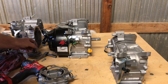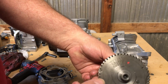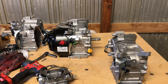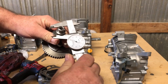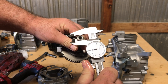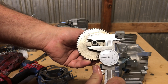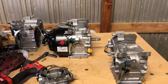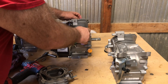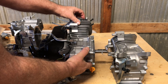The Ghost is not a Ducar. The camshaft from the Ghost has some numbers on it, but honestly it doesn't look anything other than stock. I haven't put a degree wheel on it or anything, but I'm not impressed. The camshaft size is about 549 thousandths, so it's clone cam size.